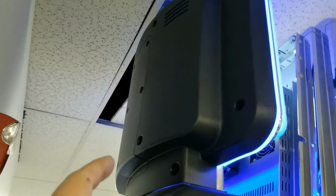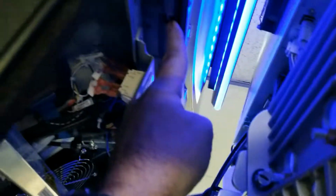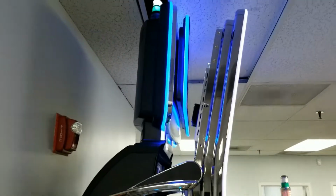Believe it or not, the J43 is actually a lot easier. You still need to unplug everything from the back, everything, because you don't want to unplug anything down here. You're going to unplug everything from the top, and all you have to do is take a lot of nuts, just a lot of 7mm nuts, off of the entire bottom plate. They're everywhere, in the back and in the front, and you can get the entire topper off of the J43 a lot easier. There's no mounting plate to remove or anything crazy.